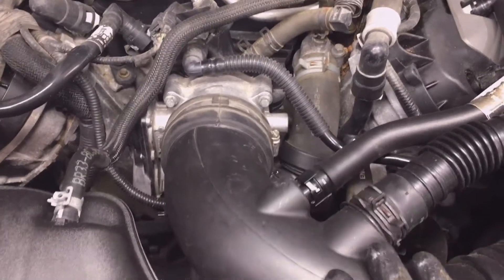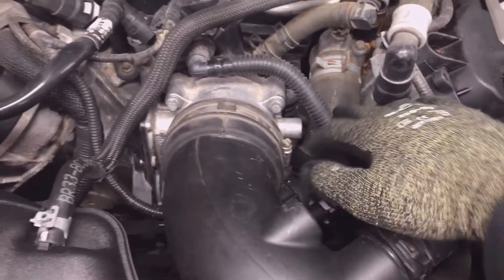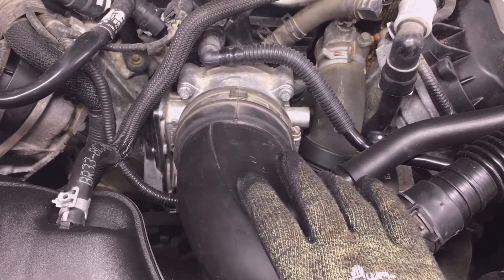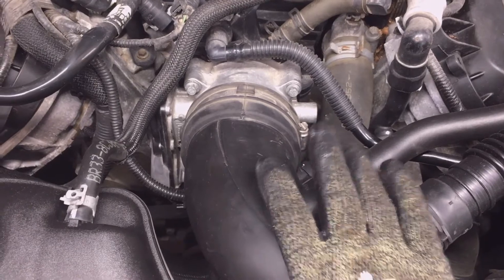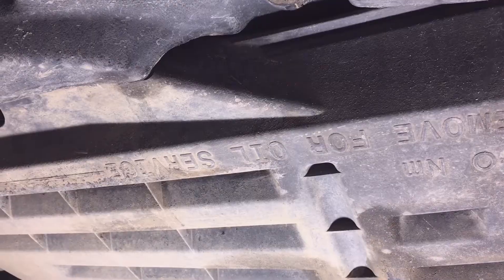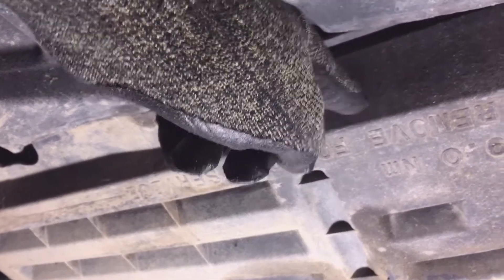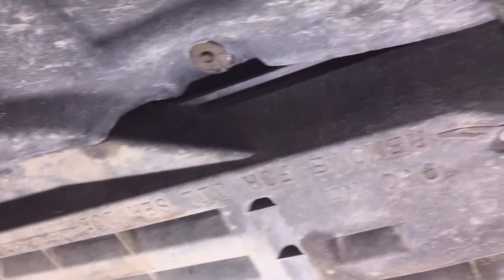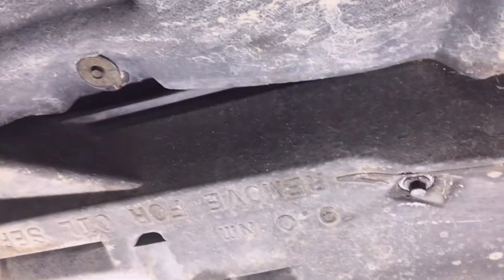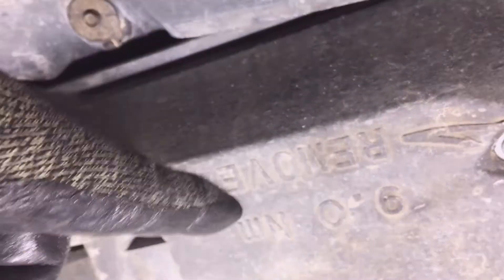If you choose not to do that cleaning and service on your cold air tube, you've got to get down in and attempt to see the best you can from the top of the engine to determine the state of your belts and hoses. Let's move underneath the car. If you're doing this as part of your oil change, you're already going to remove the engine access panel underneath the car. There are three 8mm head bolts to remove, torqued to 9Nm when reinstalled.